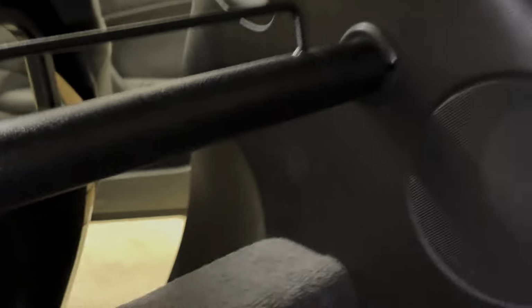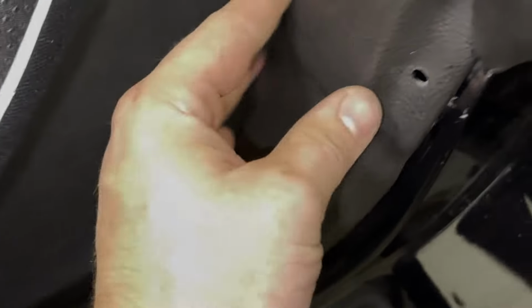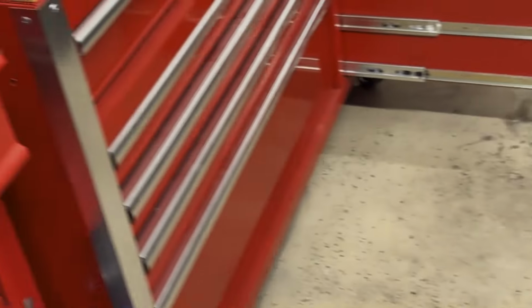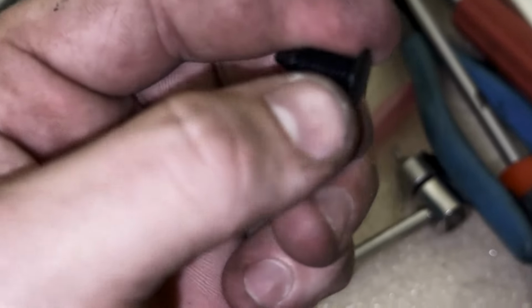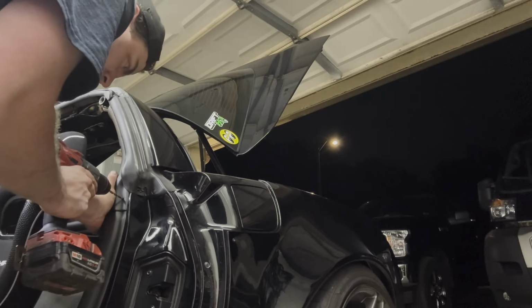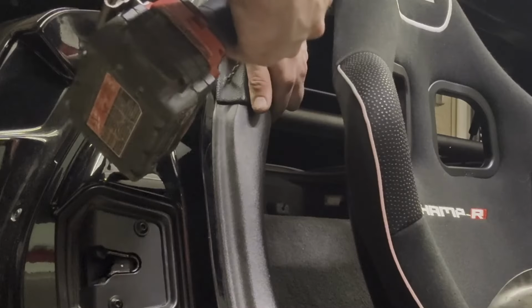All right, so got them all fitted in, got the grommets, it looks pretty good. Super pleased actually with how all that fit. So now what I'm going to end up doing is these original little pieces right here are going to need to be drilled out to 3/16 because they give you pins that you press in there. Found the original hole. There we go.